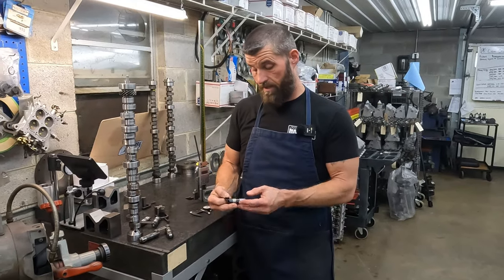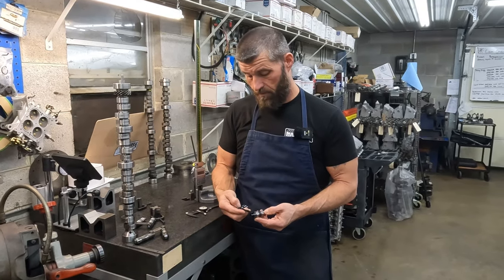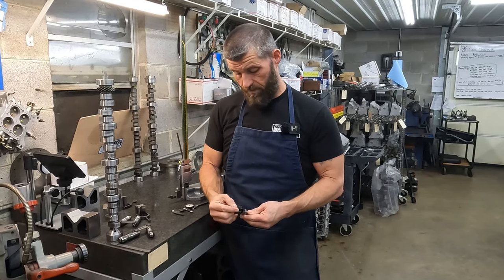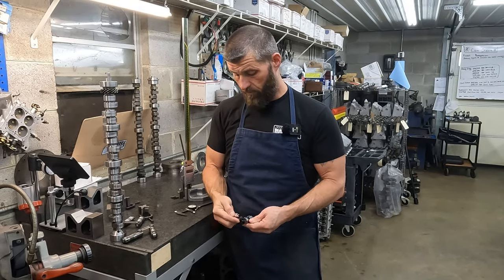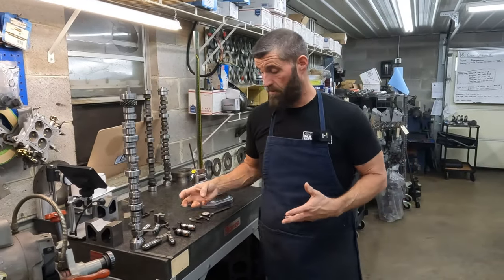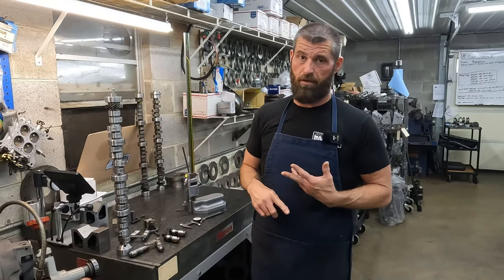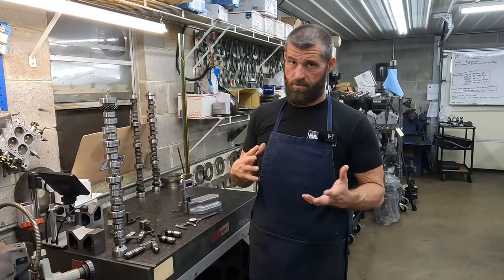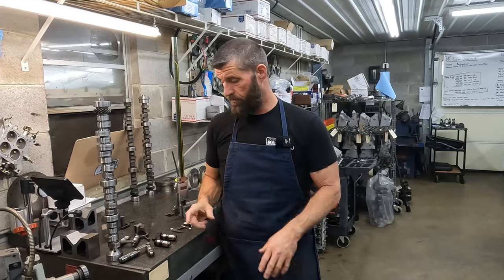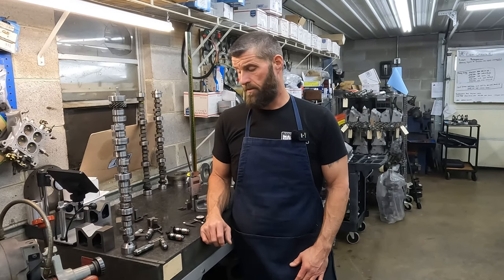I can't confirm the part number — I don't see any part number on it at all, just their logo. It's possible it's the wrong part number, but my understanding is that with the tie bar widths on a big block Ford and an FE Ford, that's how it works and no other lifter has the bar spacing to fit. Structurally they look like everybody else's — it's just the oil band is in the wrong place. Just be aware of that.